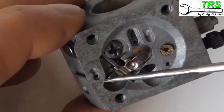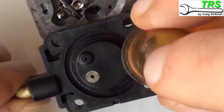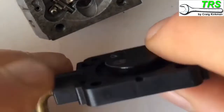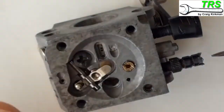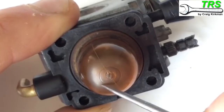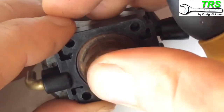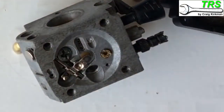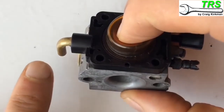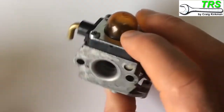That's where the air-fuel mixture adjustment comes in for a two-stroke. Now let's look at how the primer pump works. Inside there's a valve and a little spring. Under the primer pump there's a little hole and a couple of valves - when the primer bulb is pushed down it pushes fuel out through one valve, and when it rises it draws fuel in through the other, creating a vacuum. The bulb must seal properly - if there's a split in the bulb the machine won't run because it'll draw in air instead. It pulls up fuel when priming, pumping fuel into the main inlet and flooding the area, supplying fuel to the engine. When you push down and release, it fills with fuel; push again, it pushes the fuel out through one valve, draws in through another, and the return line goes back to the fuel tank - making a nice circuit of fuel.